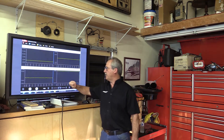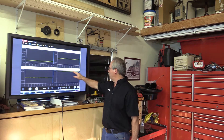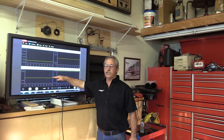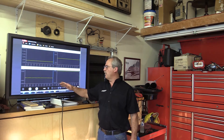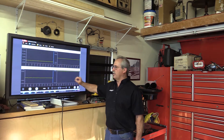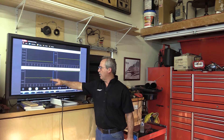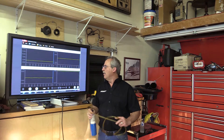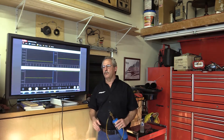On this car I have a front air fuel ratio sensor and a rear O2 sensor. My rear O2 sensor is steady at 800 millivolts, which looks awesome. My front sensor is right about 3.3 volts, which is the neutral position for a Toyota air fuel ratio sensor. Air fuel ratio sensors are inverted compared to an oxygen sensor — when I go lean, voltage goes up; when I go rich, it goes down. I also have short term and long term fuel trim displayed, and I'll use those to gauge how much propane I put in. The ideal number is about a 20% negative shift in fuel trim. This is a mass air flow sensor car, so it should work well.